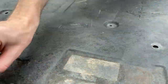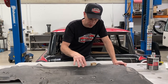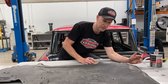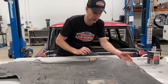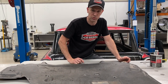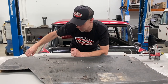We've cut and relieved these surfaces. Being a bodywork guy, I'm conscious of surface - I've looked at these to determine whether the surface underneath is being distorted, creating lumps and bumps. It's not an exterior surface we need to worry about, but it's something to be mindful of. Ideally, if you've got the bonnet or hood off the car, you can set it in its exact position to avoid building tension in it. I've got a couple of packers here in areas where I know there's a curve, to keep it in its original form. I've got a bit of timber under here to keep that curve sitting naturally as it would be in the car.